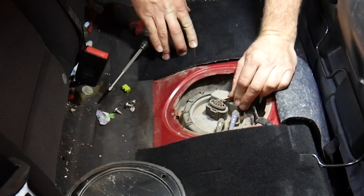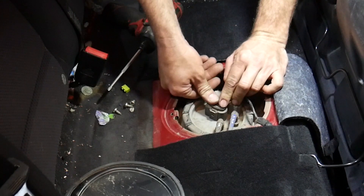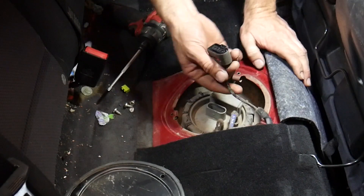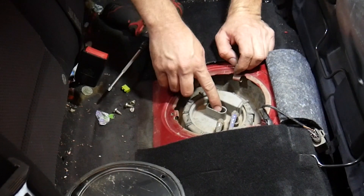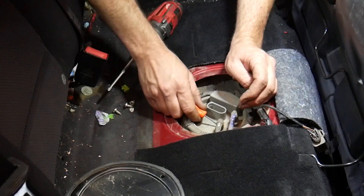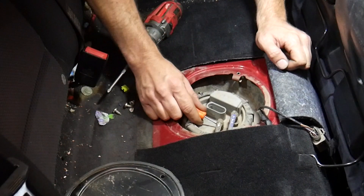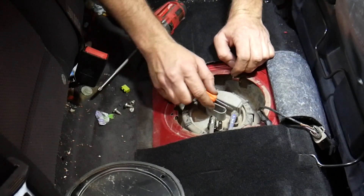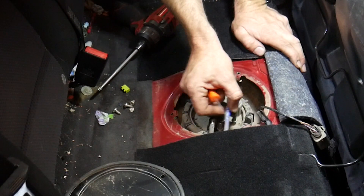Now we can unhook the electrical connector — just push down lightly, there's a little tab here. While you're pushing down on the connector, lift up on the tab and then lift up on the whole thing. It comes undone without breaking it. These fuel lines are quick disconnect — they also have a push tab but it's down at the bottom, kind of hard to get to. Sometimes just grabbing a screwdriver and pushing with the flat edge against that tab works. And those are both unhooked now.